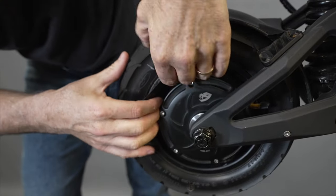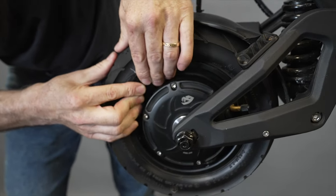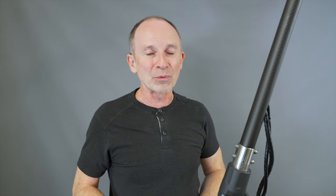It sounds kind of funky, but use tape that matches the color of your wheel and it'll look okay. I only stuck two weights on this side, and the reason is I'm going to take the other one and stick it on the other side. We want to get the wheel as balanced in all directions as we can. If you have four weights, put two on one side and two on the other. With three, you do the best you can.